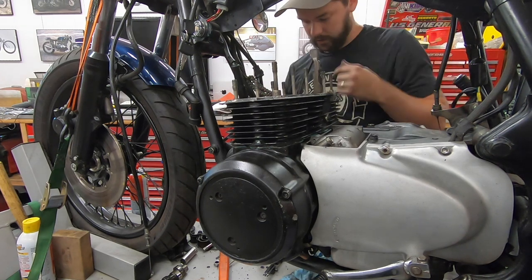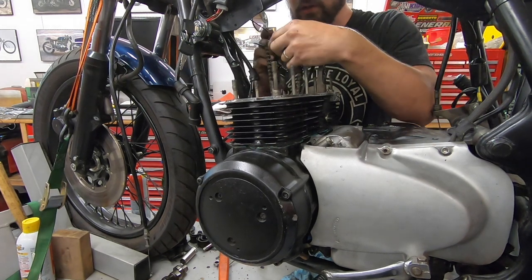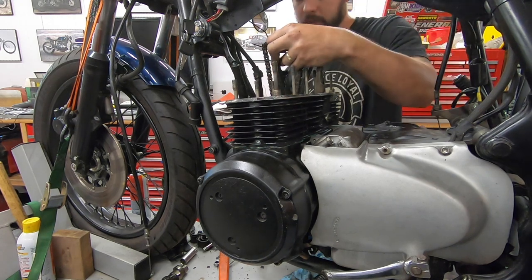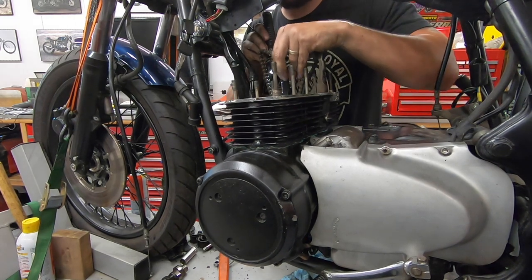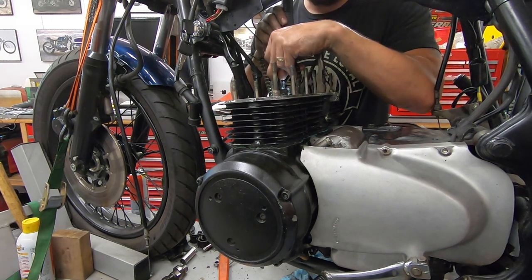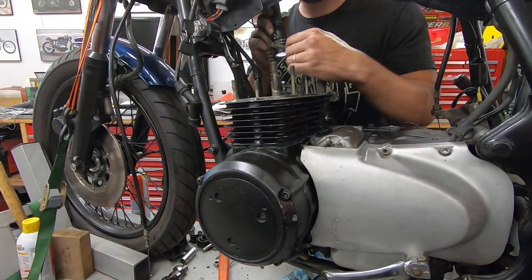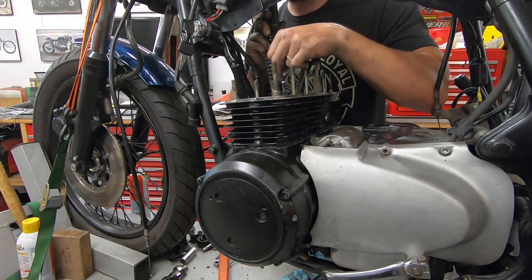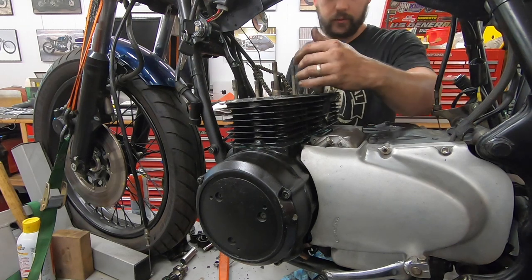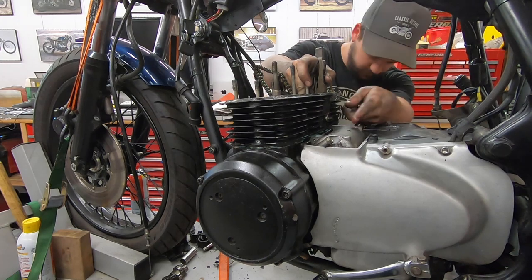And then we can put our front tensioner on as well, making sure the up is in the up position. It's going to go down, turn 90 degrees, stick into the little pockets just like that. Make sure it's seated in. Cool. So now those are where it's supposed to go. I can go ahead and throw my little lock nut and stuff back on here as well.